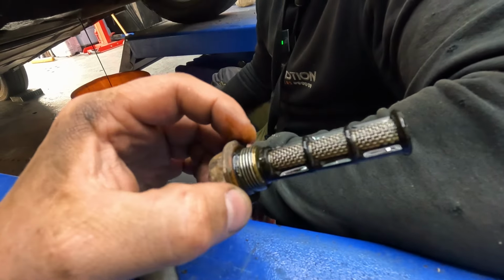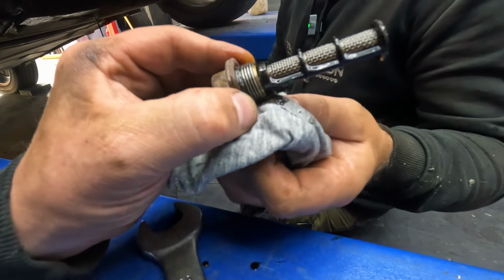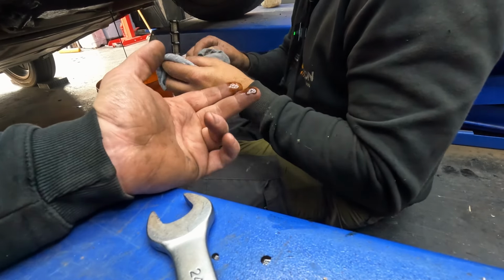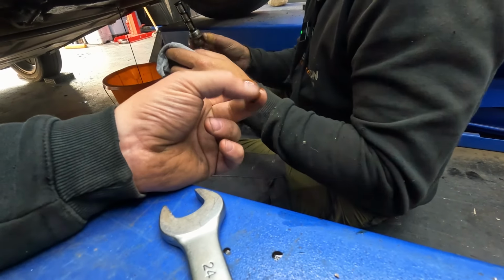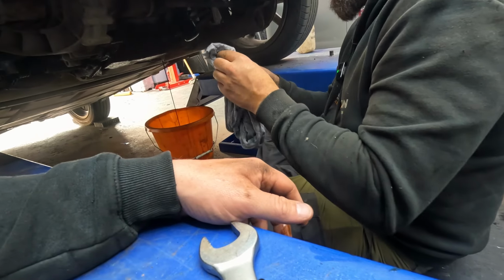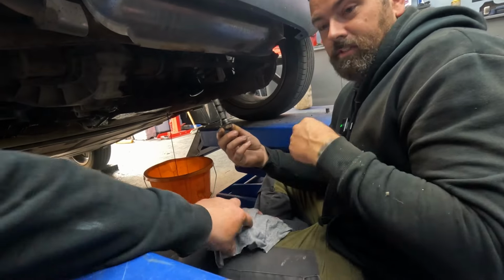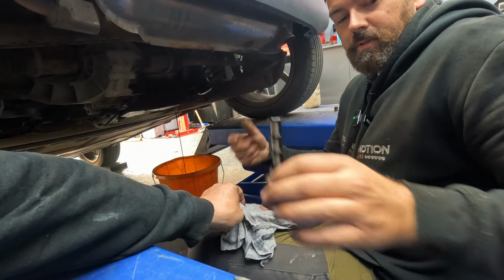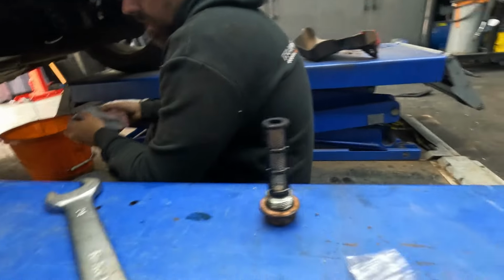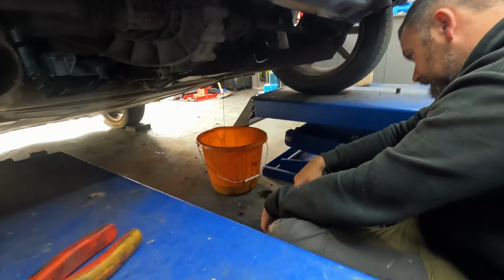Anyone tell us why that's on there? Unless it goes in there when it gets to the lowest point and then it struggles to be pumped back round. Clean oil, that though. There is a chance that if the big ends are gone, if you hadn't done that rattle test, someone could have changed the oil, it'd come out clean and you'd think it wasn't there. But with us doing it backwards and forwards, there's not much oil in it, I'll tell you that.